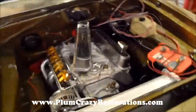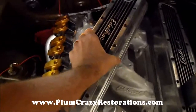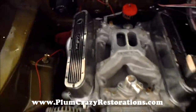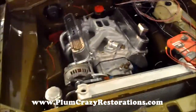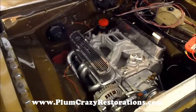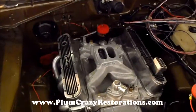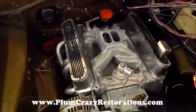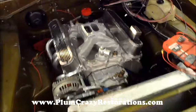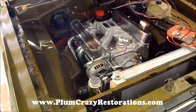The engine has a full roller valve train setup, so a lot of movement in the valve train on this one. One issue we did run into on the engine was the adjusting locking bolts for the rocker arms were previously loctited with a liquid thread lock — and that's a no-no. So once we get those corrected, we'll get those reinstalled into the rocker arms and then continue on with the engine build for the 360.